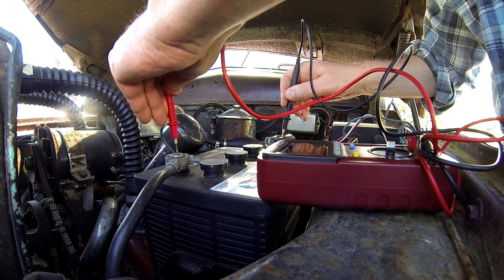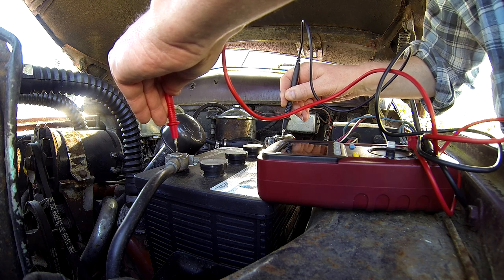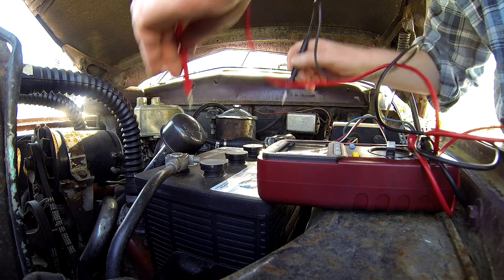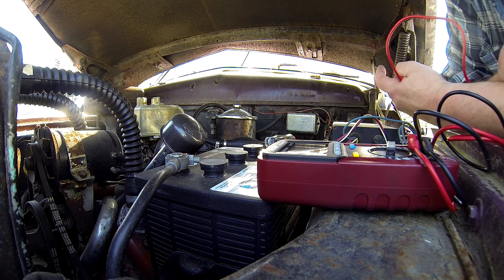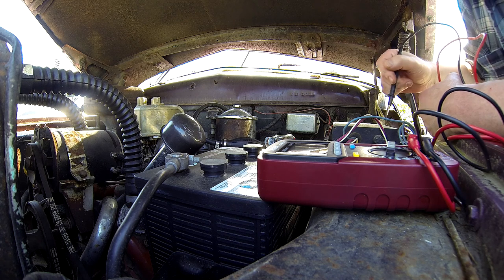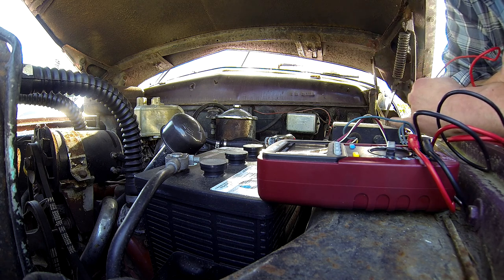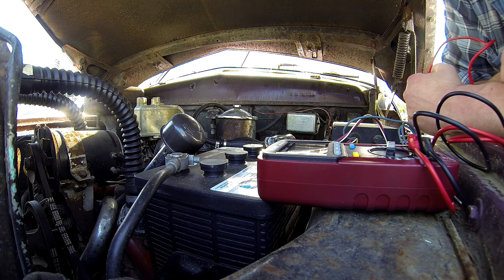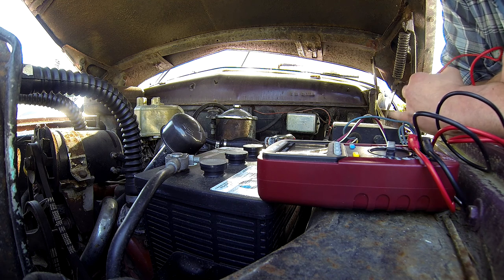Not too bad. 6 1/4. I was worried it had gone way down. I'm not aware of any leaks right now. The one thing that I do know leaks, you won't see this probably, is this 6 to 12 volt power converter here, which is for the windshield wiper motors. And that's been disconnected for years because it was a parasitic loss.